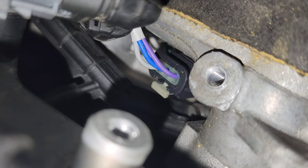Now we move over to connector 3B. Same process with the pick tool — pull out the blue connector from 3B. This connector also has reference numbers on it to help with counting pins, so look closely on both sides. We've got two more wires to remove from this harness using the pin tool the same way. Then we switch back to the body domain controller and use the red and black wires to get power and ground for the reflex. Pay attention to where the retaining feature is on the pin, push it into the appropriate pin location, and make sure it's locked. Then push the blue piece back into the main connector and reinstall 3B onto the footwell module.